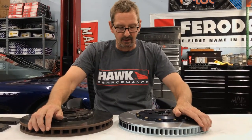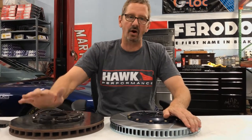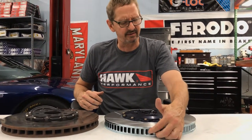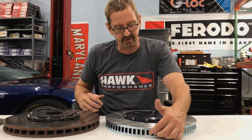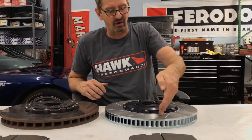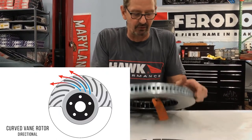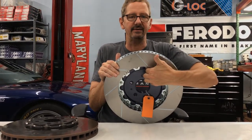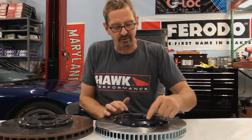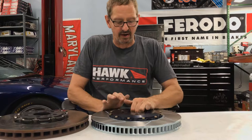We do think that the Gyrodisk rotor makes a pretty good replacement option. The Gyrodisk ring has a couple of advantages over the OEM rotor. The first thing is the vane density is considerably higher — this is a 72 or 84 vane disc. It's also a curved vane disc, so the vane is curved, which makes the rotor ring a better fan. As the rotor spins, you're drawing air in through the inside and blowing it out at the perimeter of the rotor, with the air moving along the vane to take away the braking heat.